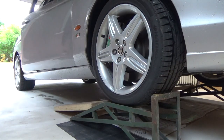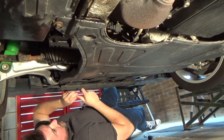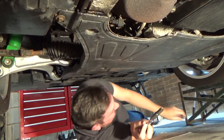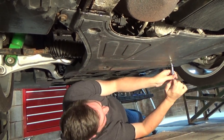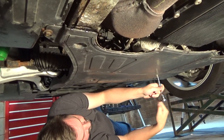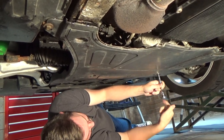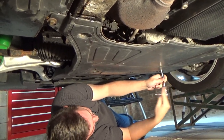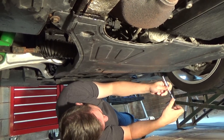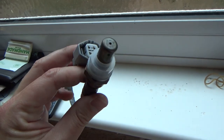So you're going to take the splash guard off completely? Yeah, you could probably get to it without taking the guard off, but this is the R version, so on the near side cat you don't have the oil filter in the way like you do on the 3 litre version, because the oil filter's at the front of the engine.